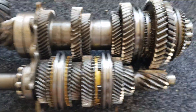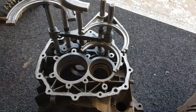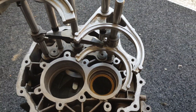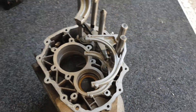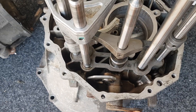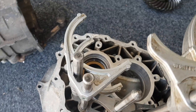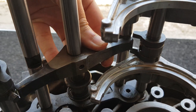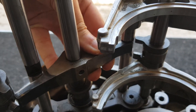These selectors are moved by selector forks. The forks are in place on here — there are two operating on each shaft. They are operated by cables. There's one cable which rotates to select which selector fork is actuated. There's a slot on there for the first and second fork, third and fourth, and then over to this side for fifth, sixth and reverse.